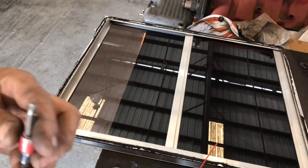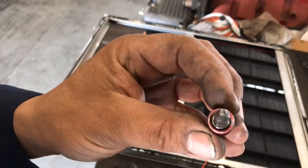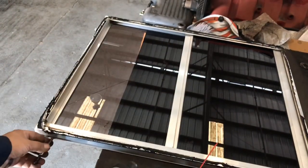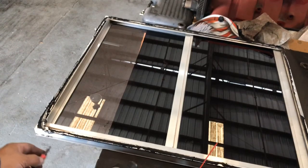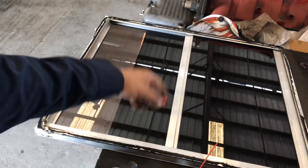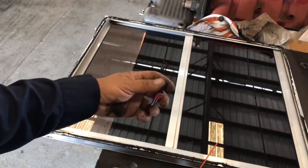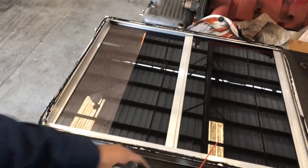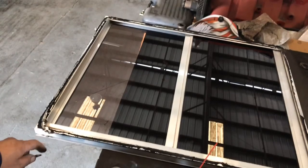Well, on this one, guys, this is the bit we use for the windows. It's an S2 square bit. This is what we use for the screws: you've got two here, one here, and then again on the other side. You use the S2 bit to get those screws. These two, you loosen. These four, you remove. So let me get that done.